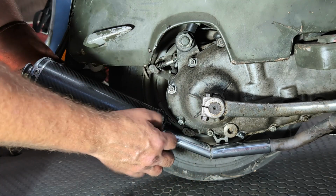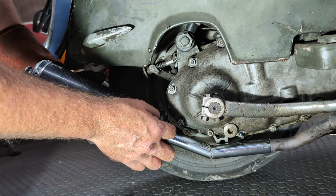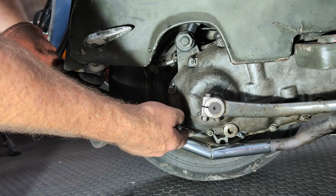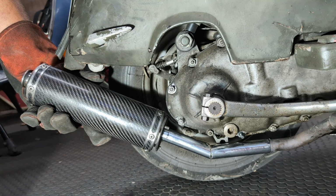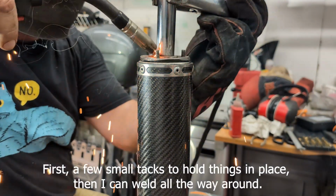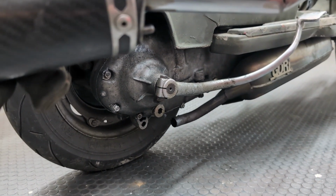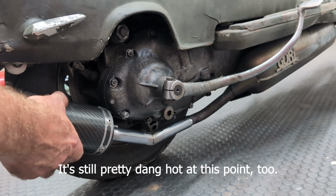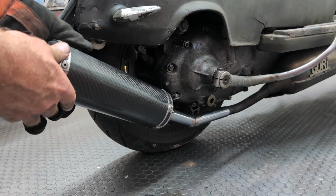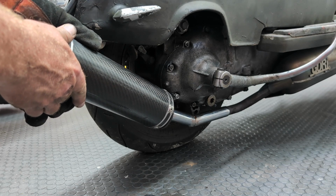Yeah, we'll come back. Once I have all of this part done, I'll start to worry about this. And what I'll do is prototype this using a piece of cardboard, figure it out, and then I can cut and weld. And it'll come up, it'll support onto this brace here, as well as down, like a rib down to here. So it should be pretty freaking strong. And it will not saw through or vibrate to death like the aluminum that was on there did. I'm good to go. Let's get this thing welded up.